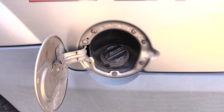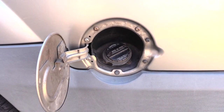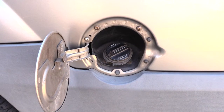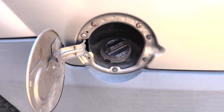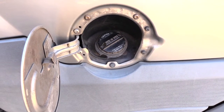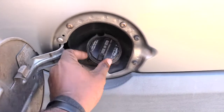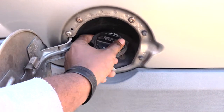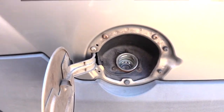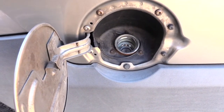I'm going to show you a quick way that you could test your fuel pump, just in case you think your fuel pump may be bad because you're trying to start your vehicle and it won't start. What you can do is go to where you put your gas in, go ahead and take your gas cap off, and then get somebody inside your vehicle to try to turn the vehicle to the run position — don't try to start it, just turn it to the run position.